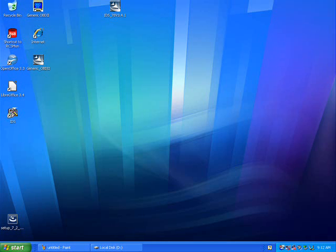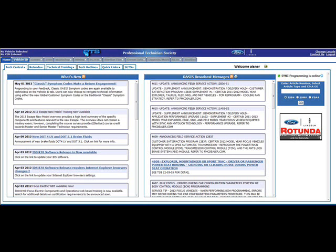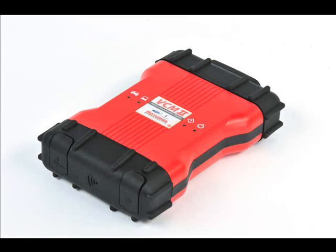There are other wireless managers that Windows 7 and XP may be using on your PC, and the procedure to switch to the Microsoft Wireless Manager may vary. The procedures for the most popular wireless managers can be found in the VCM2 Wireless User Manual on the PTS website, along with other VCM2 information. This manual also covers how to set up the wireless in infrastructure mode by connecting to a router in your facility. The VCM2 also comes with a feature to reinstall the software or loaded code on the VCM2.